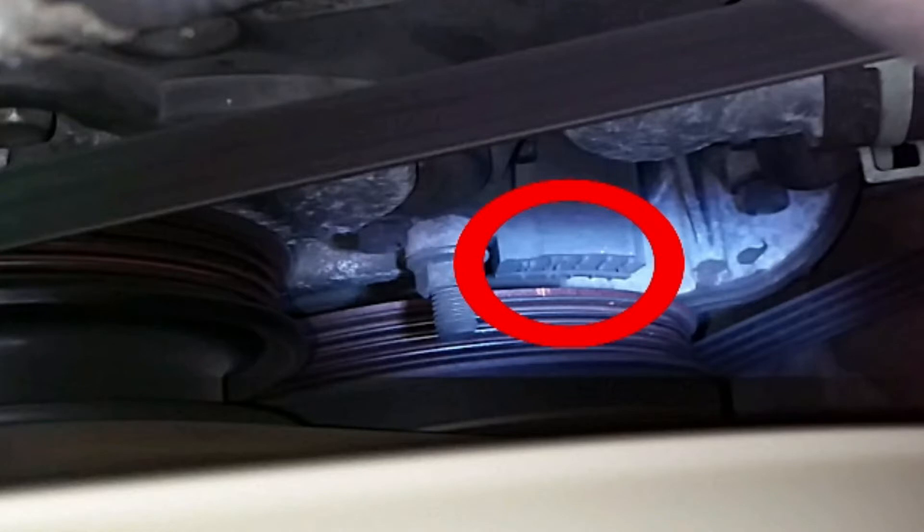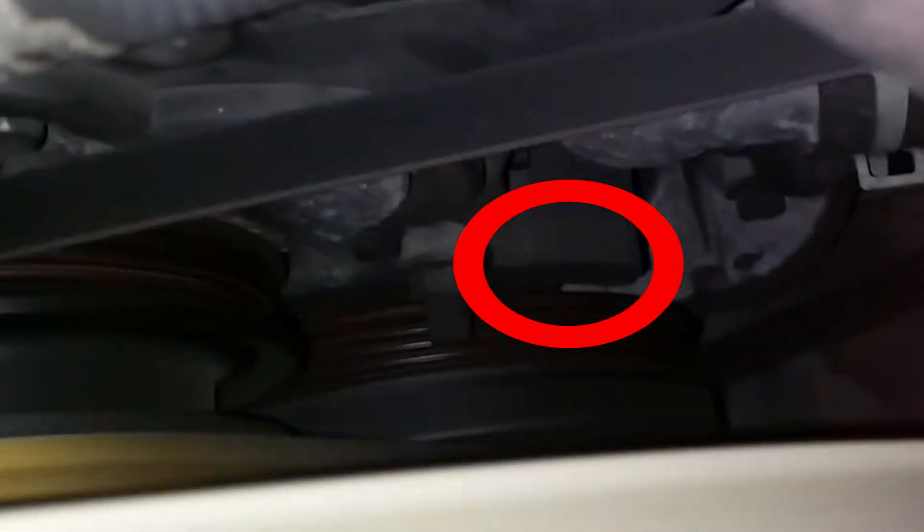Some of you might be asking what are we actually looking for. We're checking for the indicator or gauge that's mounted on the block of your engine, that is going to line up with the timing indicator — a single mark on your pulley. This is zero on the gauge; it'll read five degrees after top dead center and all the way up to 15 degrees before top dead center. We are going to try to line it up with 10 degrees, which is right here. The timing specification allows plus or minus three degrees to be okay with smog.